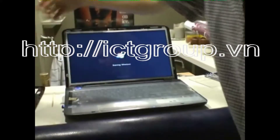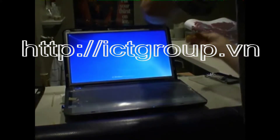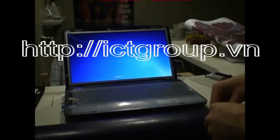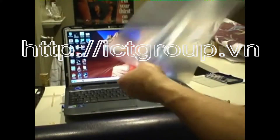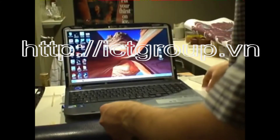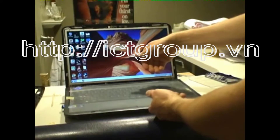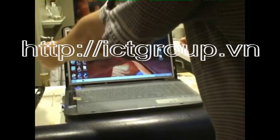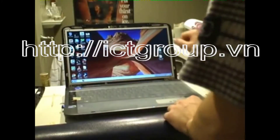Put the three screws back in on the sides. For the top ones, you can fold out or pull out the metal frame a little bit so your screwdriver can fit in easier — it's kind of tight, just a couple millimeters. Turn the computer on to test: the new screen is working. I also noticed that the protective sheet tape can fold in around the screen, so before you screw the screen in, keep the protective film on while plugging the wiring in. But before you flip the screen up into place, take the protective film off so the tape comes off easily, and then push the screen right back into the frame.